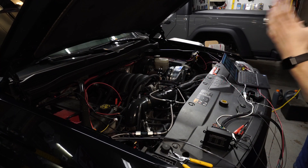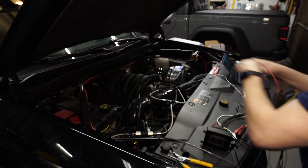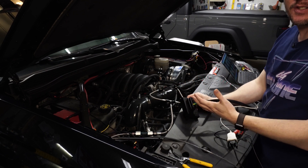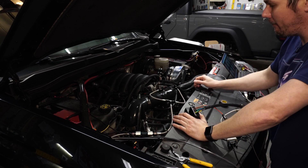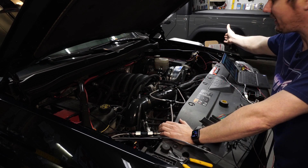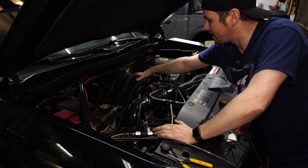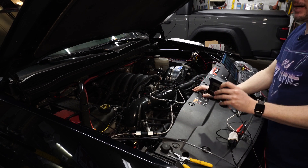Let's dive underneath the hood and take a look at what's going on. We've got everything just loosely wired in here. Here is our micro squirt. We have depinned a lot of this just to give us the requirements we need, plus possibly use a Mac solenoid valve for a boost controller with the bypass valve later on. The big goal is we've got a Holley Hi-Ram sitting back there with some 42 pound injectors. We will be replacing our intake manifold with that Hi-Ram and controlling those injectors in batch fire off of the micro squirt.